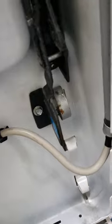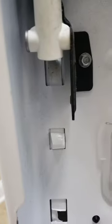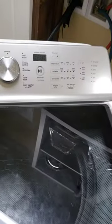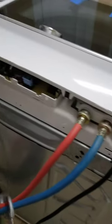I lifted it up, and there are silver clips — take some pliers and squeeze that together, then take this one hiding right up under there, squeeze that one too. The top control panel comes right off. I've already had it apart and I'll show that in the next part of the video.